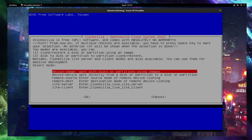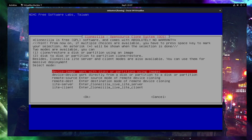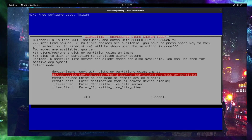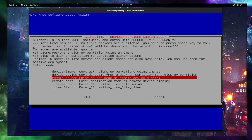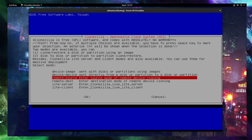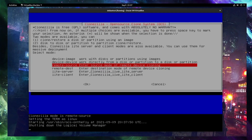And then I have a number of choices. The first one is disk to image — this is actually taking your disk drive and converting it to an ISO. To do that one you need to have an NFS server or a Samba server. There's a number of other options as well. This one allows you to move just the partition, so I can choose what partition I want to clone. Or I can take an entire hard drive and move it as well, but you need to have a duplicate hard drive on the machine. The remote source is what I want to be using today — this is the source of the Debian install that I am going to move. And then there's also source destination, which will be where I want to move it to. And then there's light server and light client.